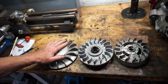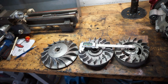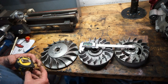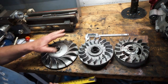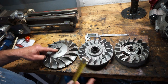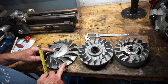Now, the Vespa flywheel - the cart horse of Europe. The diameter is 200mm on the Vespa. The larger the diameter of the flywheel, at the same RPM, you have increased fan speed. The bigger the flywheel, at the same RPM - at 1000 RPM for example - the speed of this fin will be much faster than that one. So therefore it's flowing more air with less revolutions.